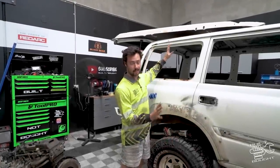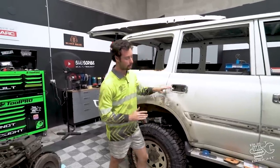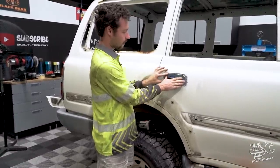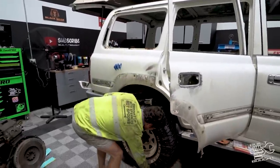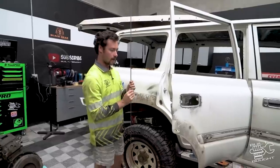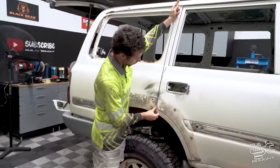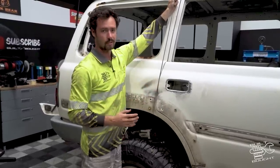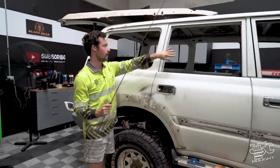Back to the back end of the car — now that we've cleaned out the engine bay I'm going to start welding in the back panels to make this a panel truck. I'm going to start with the bottom half and worry about the window sheets a little bit later. I've already had a bit of a play taking the door handle out — we've got to shave that off and put in a little infill piece I've cut out. Inside, I've gutted this door and I've got some four or five millimetre solid bar. That's the last time that door ever closes — I'm going to weld in a piece of bar in this gap. I'll do a few tacks along the joins so I don't heat it up too much, then fill the rest with fiberglass filler for extra strength.